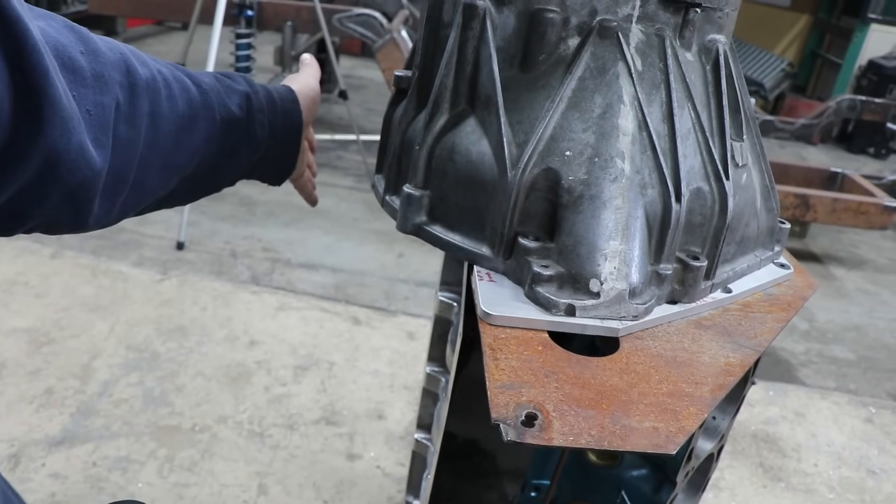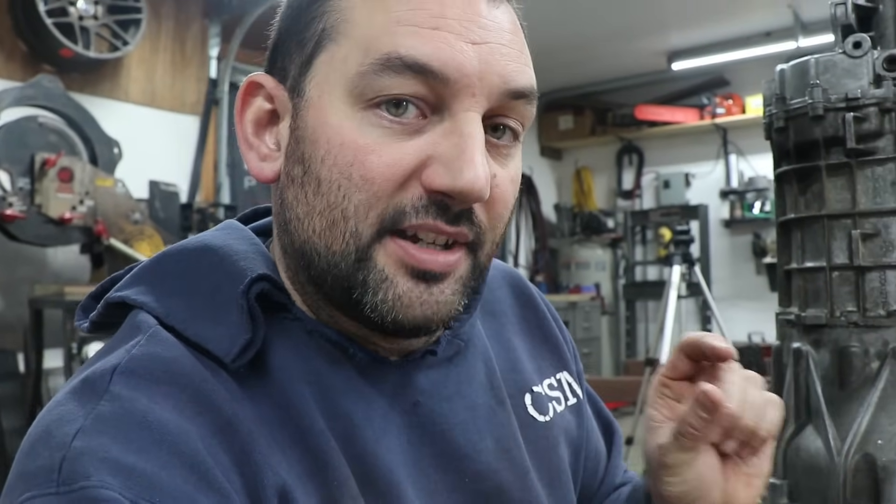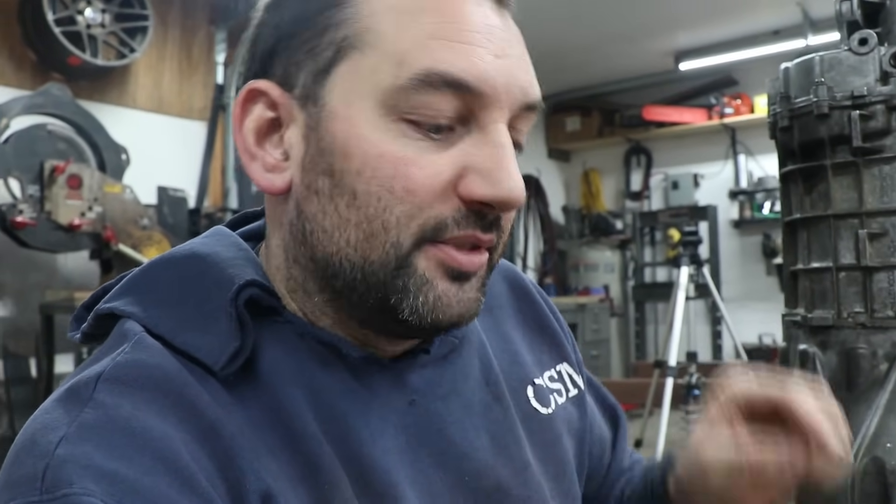I also had to have a little extra material on the bottom — say two inches below your crank centerline — to take up any bolts down there. If you've got a transmission with more bolt pattern on the bottom, you'll need more of a full circle. The way to start is with the center of the crankshaft point, which lets you either make a jig to line up the block-side stuff, or use it like I did: off the input shaft of the transmission, since the input shaft stuck out enough to machine that first hole on crank centerline as a basically alignment pin.